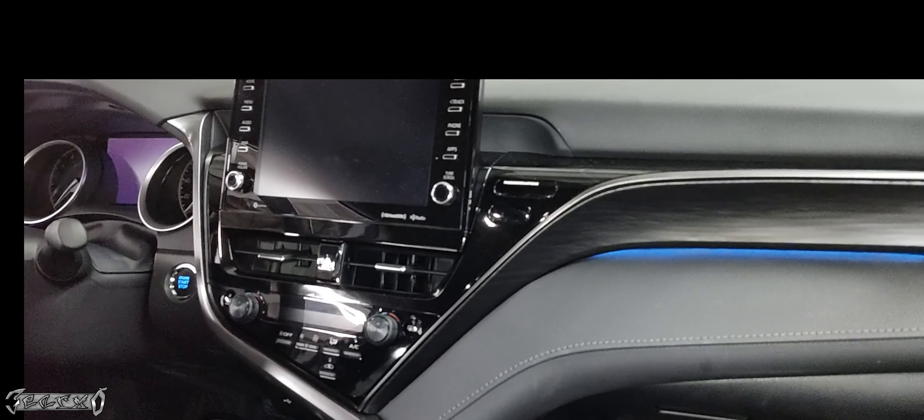Pop the lock up so it looks like this, then put the wiper arm hook right into the opening and slide the wiper blade towards the passenger side of the car. Once the hook is in and the blade is slid into position, close the lock. That's how you do it — same procedure for the other side. Do your passenger side and you're done.